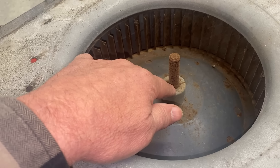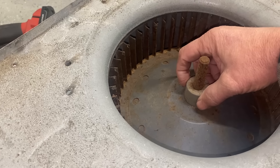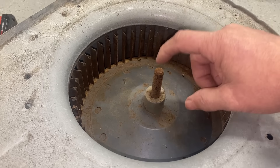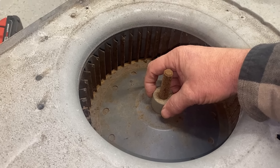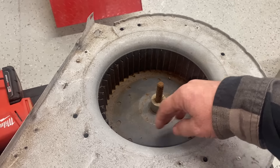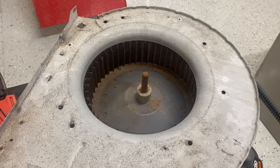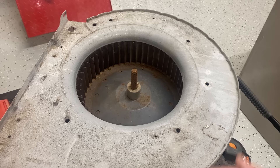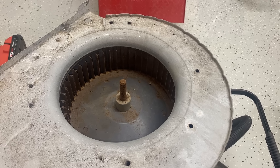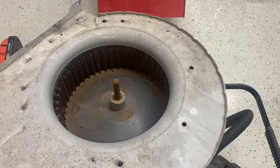If it's a really tough one that won't move, you're going to have to really tighten those puller bolts down, which is squeezing this hub — and that is the opposite of what you're trying to do. You're trying to get the shaft out of the hub, not squeeze the hub down on the shaft. A lot of guys say heat it, but you heat this and it warps the thin metal. The thing to do is be a mechanic, take it apart like a man. You don't need that little girly puller.